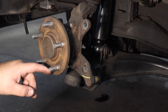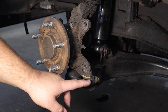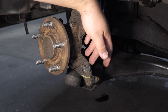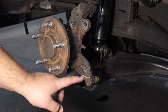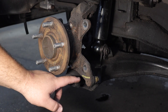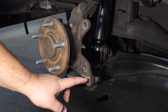Now we're at the part where I did say there is a little bit of cutting involved. On the steering knuckle right here, there is a steering stopper bolt — this does need to be cut off to fit the bracket, and then just a tiny bit of massaging on the ridge back here. About this line is where you need to make the cut, and you'll see when you try to fit the bracket if it's interfering.